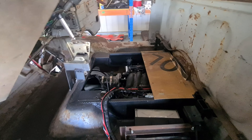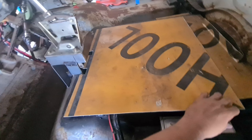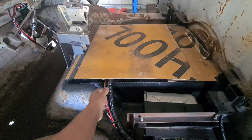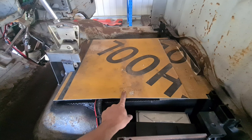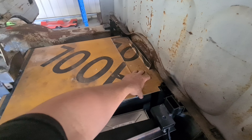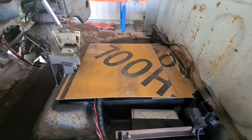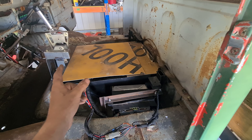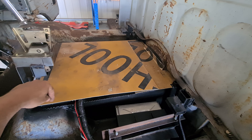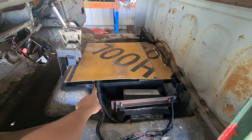The front half is cut and ready to go in. It slips inside the shifter like that and will line up with the side. It's sitting on that wiring because that needs to come through this side piece, and this will probably be nutserted to the tunnel. I'll run a couple across the back as well to try and seal it all together, and I'll probably get some foam to seal it nicely so there's not a bunch of heat coming into the cab. I'll also need to weld the nuts on for the seat so we can just chuck those bolts in without getting to the back side. A few things to do here, and I also need a grommet — I can't do any of that today, so I'm going to leave it and move on to the next job.